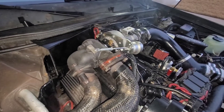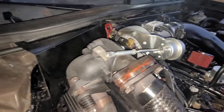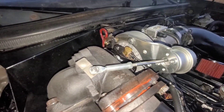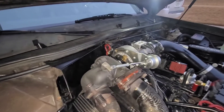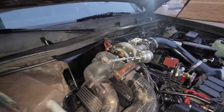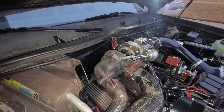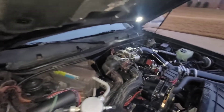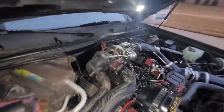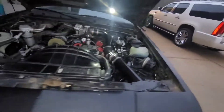You're also going to need an adjustable wastegate, because from the factory these don't come with adjustable wastegates. You can get those from Kirban Performance — they come in two different kinds. The one they have goes up to maybe 30 psi, and I think this one goes up to like 22 psi. You can go on their site and they'll tell you. With this car I'm never going to see 20 pounds of boost, so that one was sufficient for me.